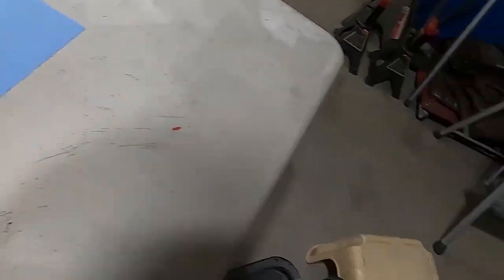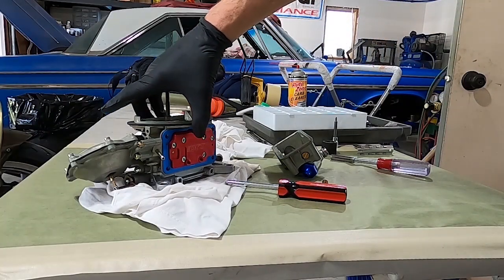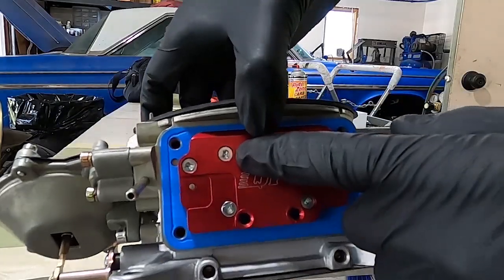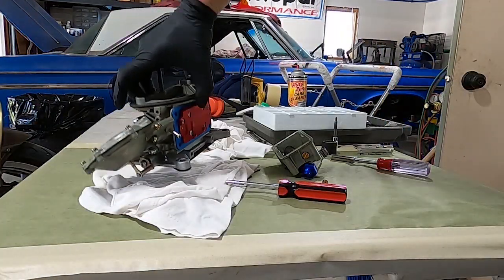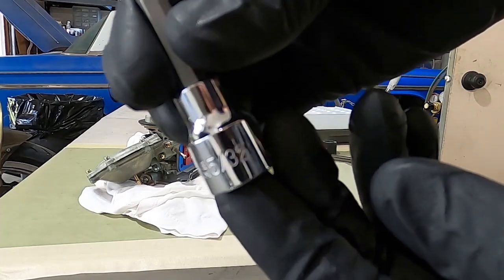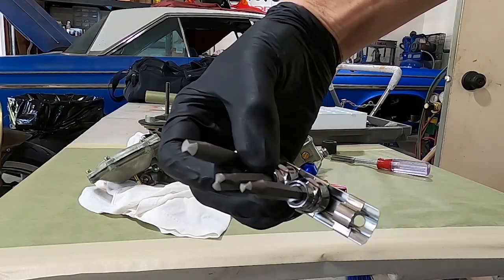Quick Fuel makes plates that allow you to change the jetting. I'll include a link in the description for those parts. Here are my Quick Fuel plates. Something to note: if you want to upgrade to these, you need a special clutch-head fastener — it's a 5/32nd — and they were kind of hard to find; I had to order mine on Amazon and get a set of four. Looking at the bigger ones, you can sort of see the shape of it — it has an hourglass shape.